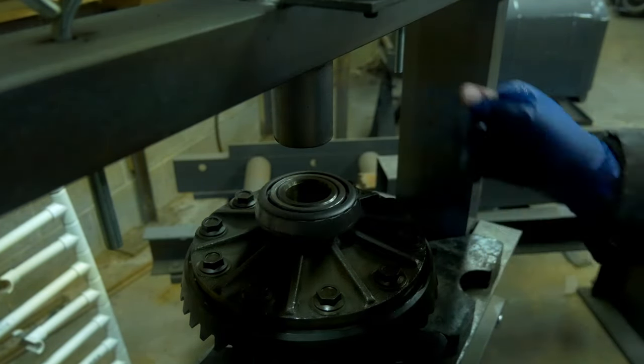Now, as you can see, I don't have a seal in the front of this yet. So the factory service manual mentions two measurements that you should take, and then I'm using the old pinion nut, as you can see there. So I just want to torque everything down to the spec. I always go to the minimum on the pinion preload, and you just use your little pinion wrench. I made one. I've got a link for one in the description below, and we're going to torque this to 137 foot-pounds. The reason being, I go to the bottom end of the torque spec, and it's always a good idea to continue moving that pinion back and forth as you're torquing this to make sure you're not binding anything up.